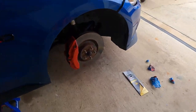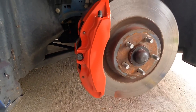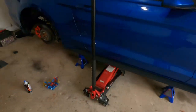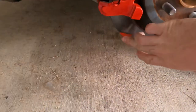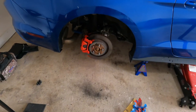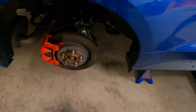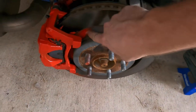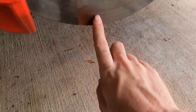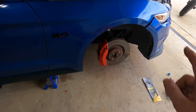Got all the tape pulled off. Everything's dry. As you can see, we got the front here — there's going to be a big black Brembo right there. That's just what it looks like bare. Hopefully we'll get that done this week. And then the rear — I didn't tape up perfect down here on the top, but it's okay because it's on the actual rotor part. When you brake it'll just scrub it off. If you get a little paint in the middle where the rotor actually contacts, you can take some acetone or nail polish remover and scrub that off. If it gets on like the actual rotor part as overspray, when you brake it'll scrub that off. So let's throw the wheels on and see how they look.